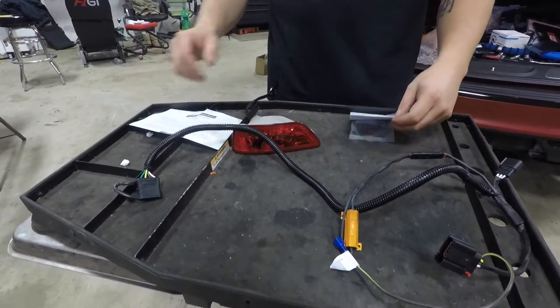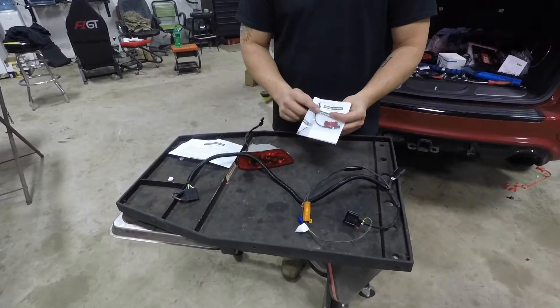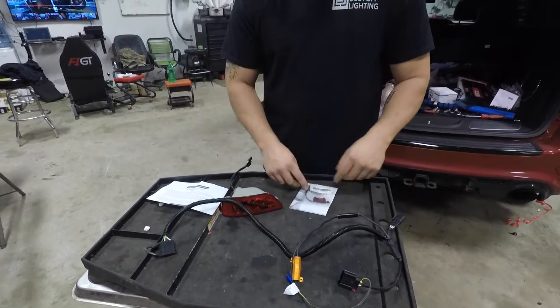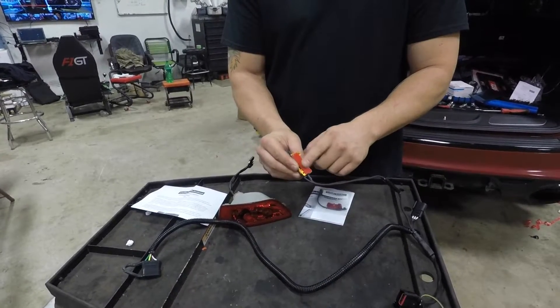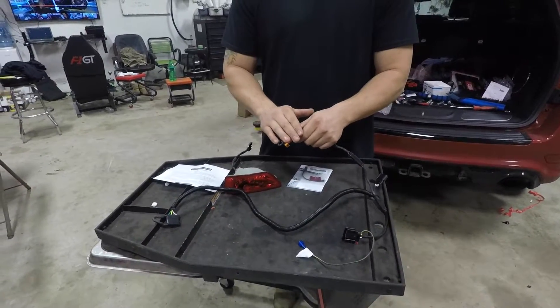You also have additional wiring for the running lights, and that will be tapped into the wire on your tail lights. They also include vampire clips for that. To hide all the wiring, they include a few zip ties as well. The resistor has a nice thick adhesive — not quite 3M, more of a thicker glue — because these resistors do get pretty hot, so when you mount them make sure it's to metal.